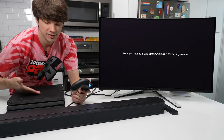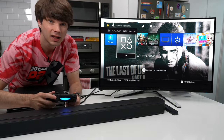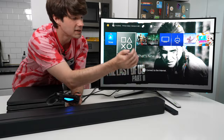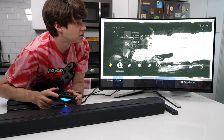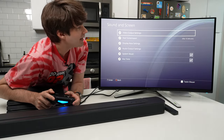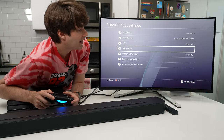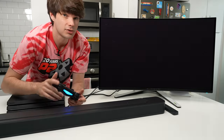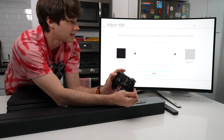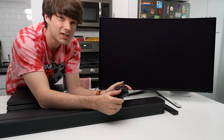Similarly, you can game in HDR with the PlayStation 4 — I have the PS4 Pro here. Unlike the PS5, it is not going to prompt you to calibrate your HDR display, even though the display is in HDR, because the menu system runs in standard dynamic range. But you can still calibrate HDR by going into Settings, then Sound and Screen, then Video Output Settings, where you will see your resolution and HDR set to automatic, which means on — then select Adjust HDR. This takes you through the PS4's calibration wizard for HDR, which is similar to the PS5's, except you use left and right. Confirm you see the image, hit Continue, and you're done — HDR is configured.